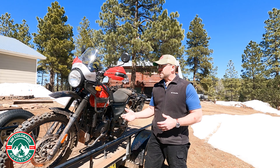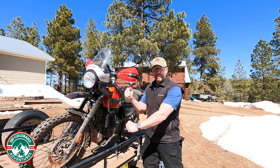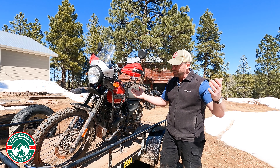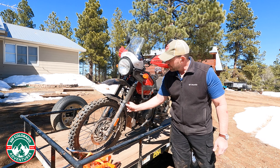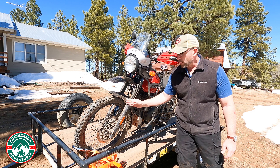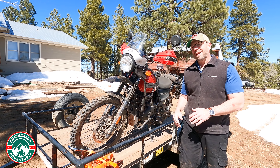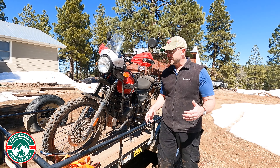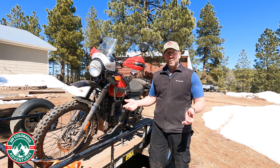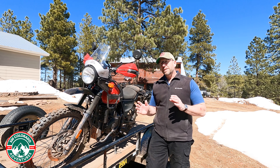The challenge with the handlebar method is that if you hit a big bump and the suspension compresses further, the line you tightened to 35 percent will go slack. So that's not actually how I do it. What I do is strap right here above the fork — below the compression point — grabbing the wheel and pulling it forward on both sides. I've taken big 700-pound Harleys, lighter-weight dirt bikes, and this bike that way and I've never had an issue. Do it however you feel most comfortable.